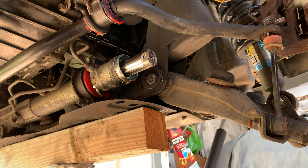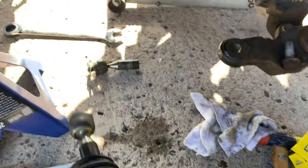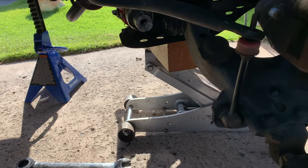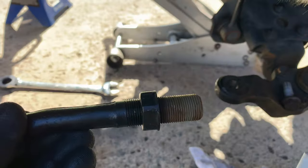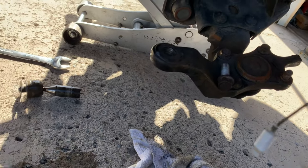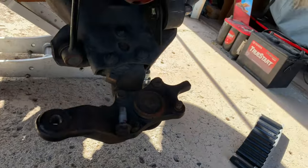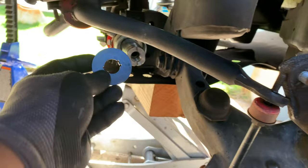And that's how it comes off — just put the new one on and we are good to go. It wasn't too bad. For the inner ones I used Moog, just because the dealership didn't have the inner ones in and I wanted this done today. I measured the threads — the original was showing five-eighths of an inch of thread, so I transferred five-eighths onto the new one. That'll get me into a somewhat drivable condition. Now we put everything back together — washer the tabs all to the inner part like that.